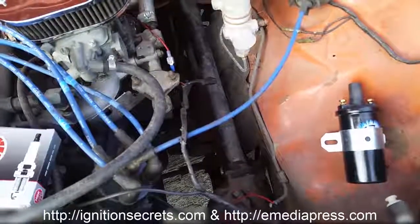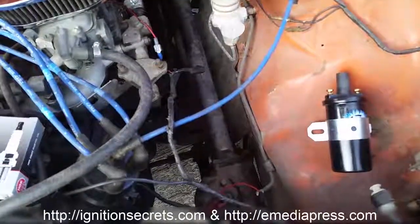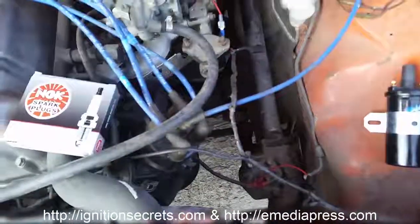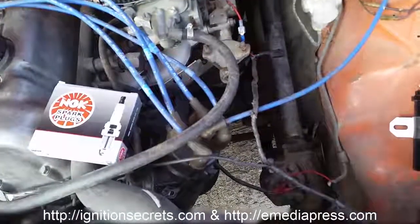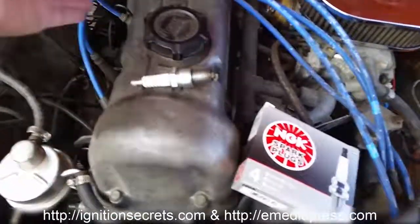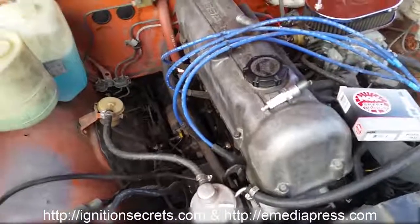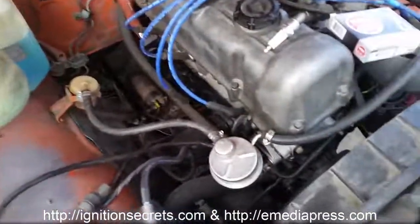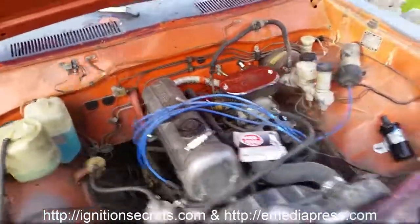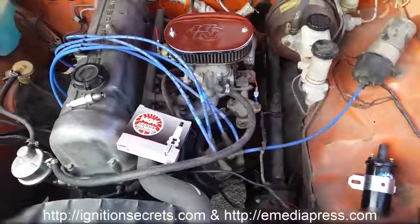And then once that's up and set, the next thing is to add my high voltage diodes from the primary of the ignition coil, which is going to be touching the positive of the capacitor inside of the CDI. And then I'm going to take the other end of the diode and run it straight to the top of each plug underneath the cables, and that'll be the plasma ignition, which greatly extends the lean burn limit. So that'll be the first step: put the plasma ignition on it with all low resistance parts, and that'll be step 1.